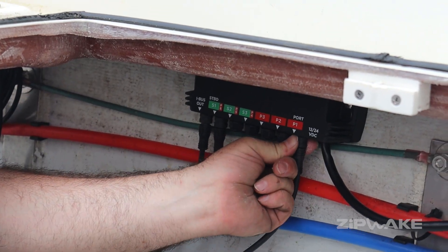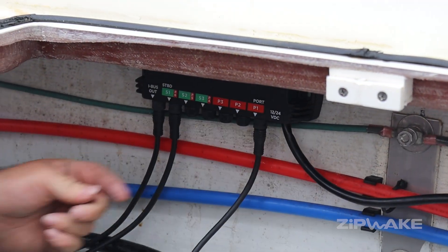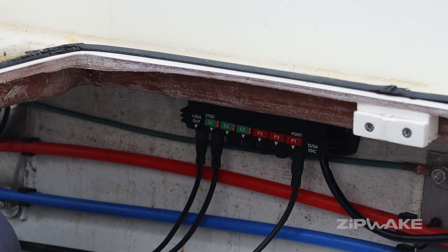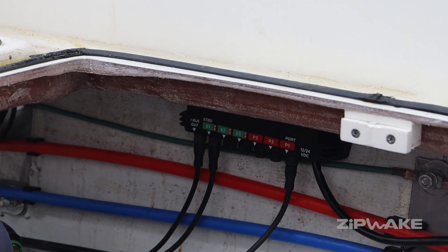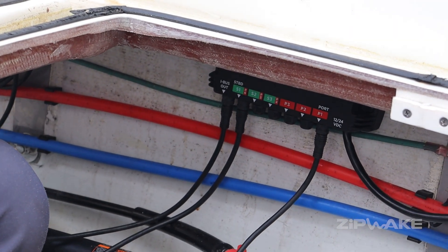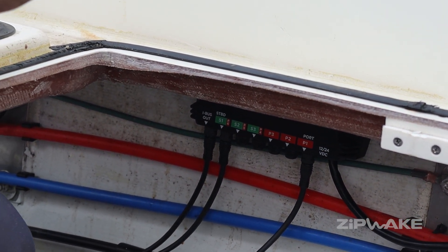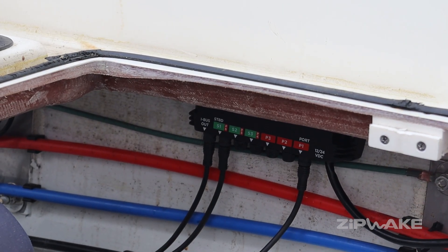Really important: when seating down these servo connectors, there are O-rings in the connectors — make sure they're not cross-threaded and those connectors are nice and tight and seated down properly so the O-rings get just a little bit compressed to make them watertight. We're going to clean up the engine room, zip-tie everything up nice and clean. We just connected power here — made new connections on the positive and negative feed, very simple. We're able to utilize those existing fasteners in the bulkhead, just loosen them up, put them in, and click them back down.